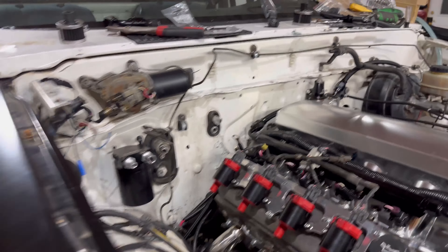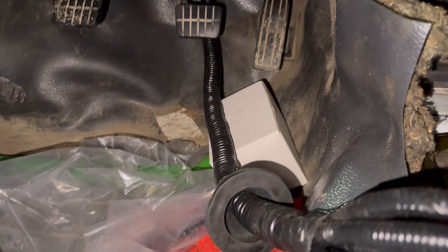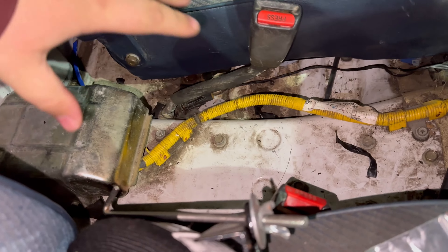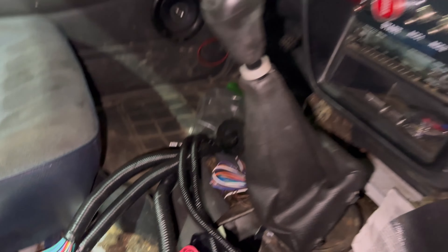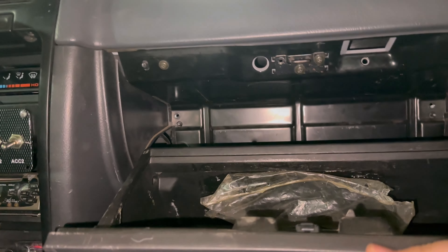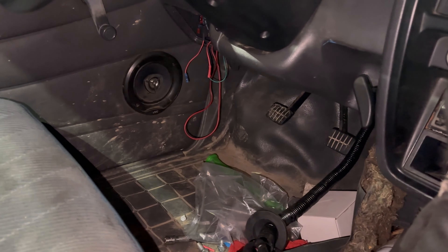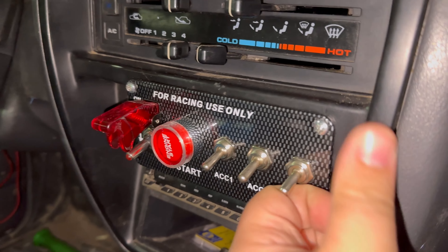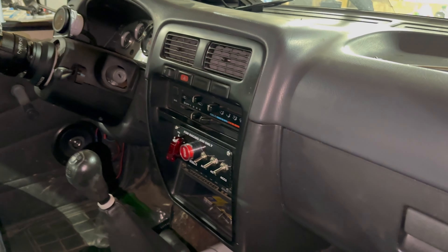The main problem is over here. Wiring comes through that two-inch hole and we've got it set right here. We were originally going to mount the ECU somewhere in back, but the harness is not long enough. So what we're probably going to do is bring it over, run the line through, and cut out a section of the glove box so we can mount the ECU — stock truck ECU — in there. That's planned for now, and it's kind of one of the last wiring steps because as long as everything's accessible, it makes it easier for us.